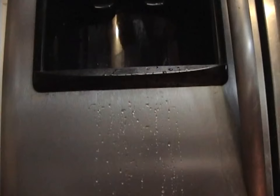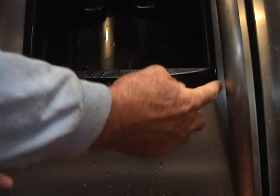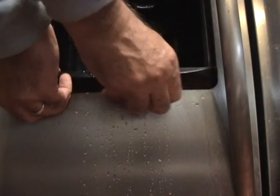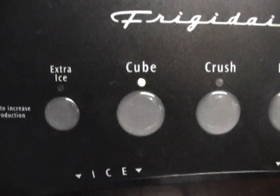On these Frigidaires, it's going to start with this little bottom drip tray right here. These little ears on the outside edge are kind of grippy and you have to just work and shake it, and eventually this thing will slide right straight out so you can get this little drip tray out.